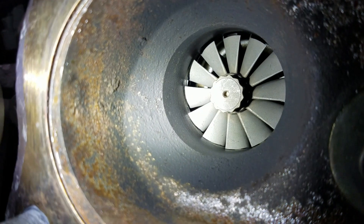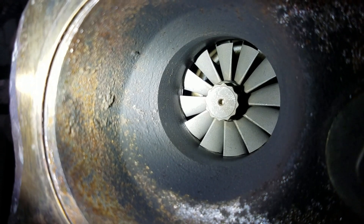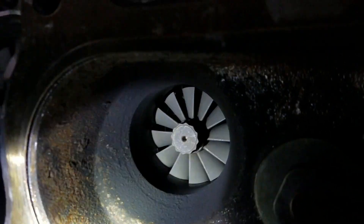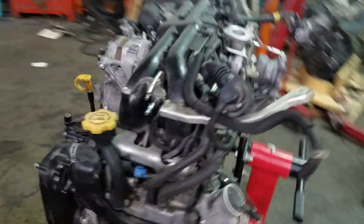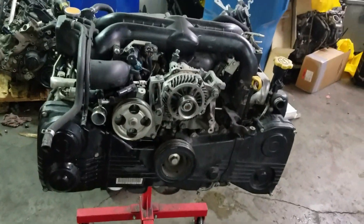Right there you can see on the outer surface — those rotors are not supposed to touch the outside of the turbo, but they are. There's quite a bit of play. I'm probably going to have to rebuild the original turbo, send this new one back, and rebuild the other one or get another turbo.